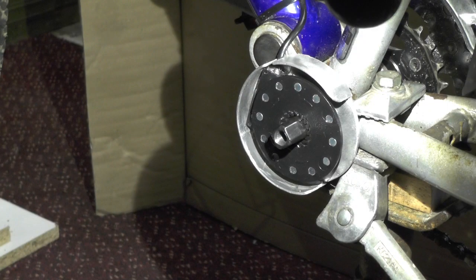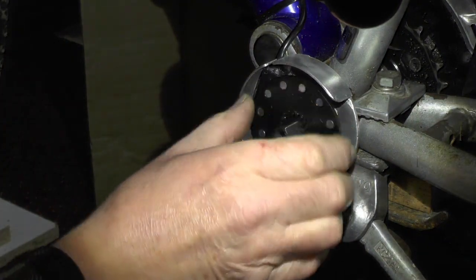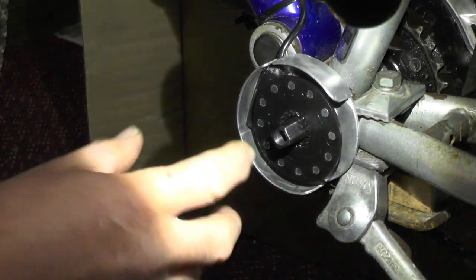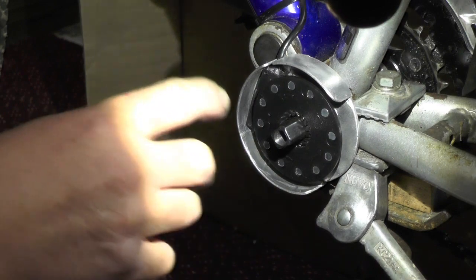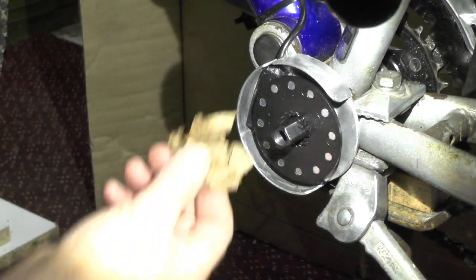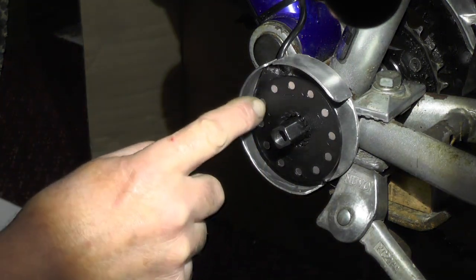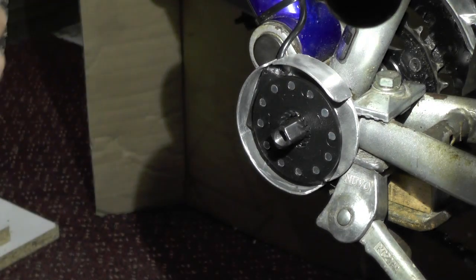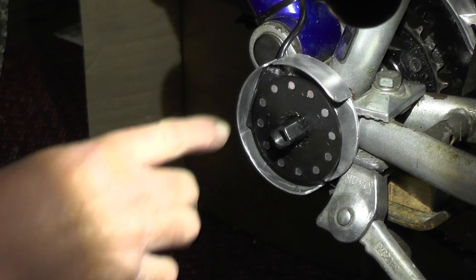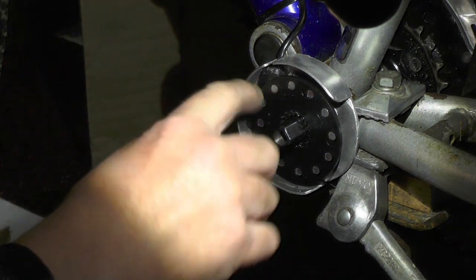What's up everybody. Today I'm taking a look at my pedal assist sensor. Recently I went out on my bike and noticed that my power was being cut when I was using the pedals — it kept cutting and then picking back up. At first I thought it was leaves getting in between the magnet, along with grime and dirt coming from the wheel. I don't think that helped because all the back of the sensor and the magnet were gummed up with dirt.